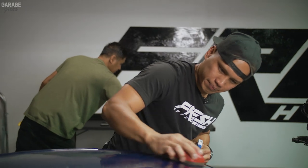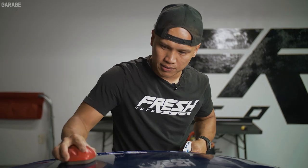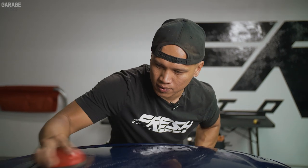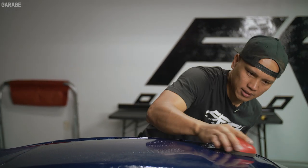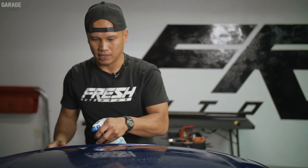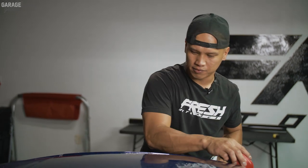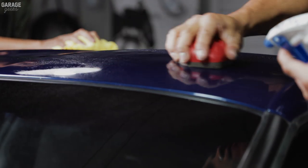I'm looking for the natural elements — dust, dirt, grime. What this does is pick up all those surface contaminants from the external environment that cannot be seen by the eye. At the end, after you wipe, you can feel that smooth surface, which once we lay the vinyl down, not only adheres more easily, but you'll see a smooth surface right above the vinyl once it's laid.